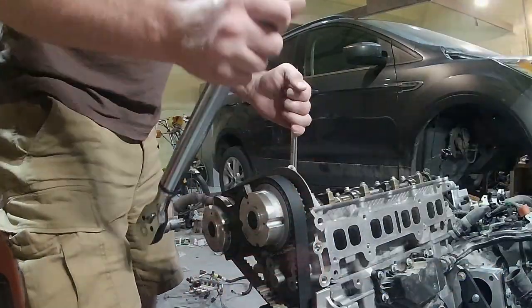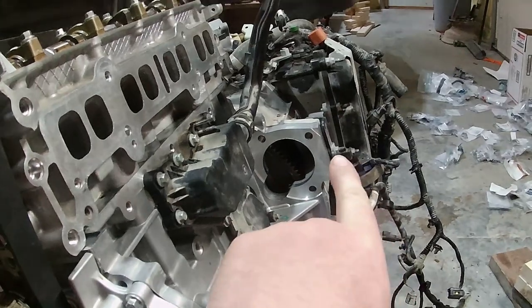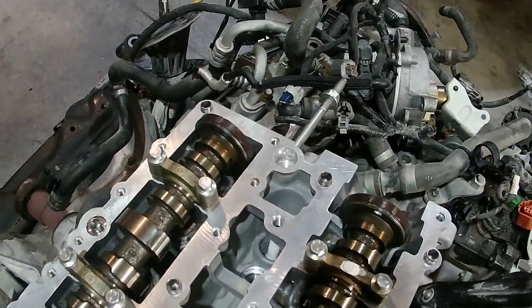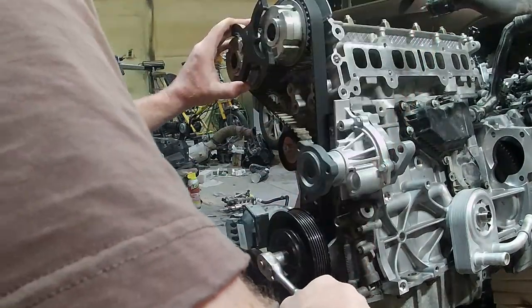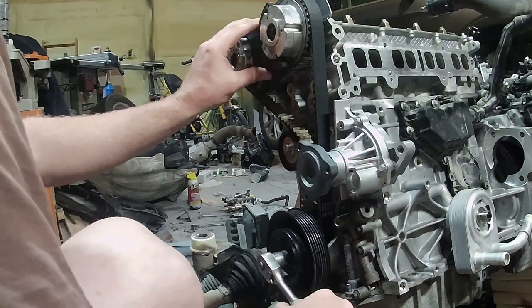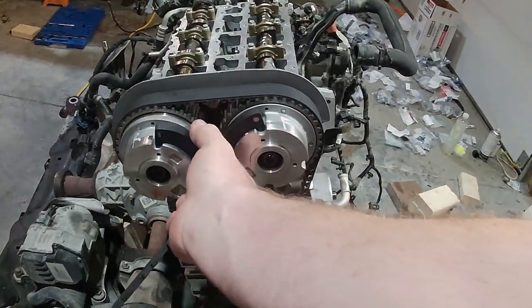We're almost there. There we go. We have all our timing tools off. Timing tools out — that's already lined up and torqued down. The flywheel gear's off, I have the cam bridge out. Now we're going to roll the engine over a couple of times and see if we line back up, or we can drop the cam phaser back in. There we go — it drops back in, no problem. And then the cam tool fits back in, no problem. So we're money — golden. Timed. That part is done.